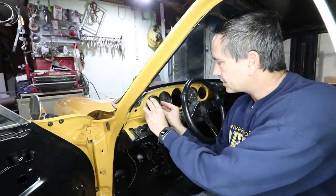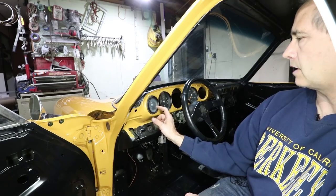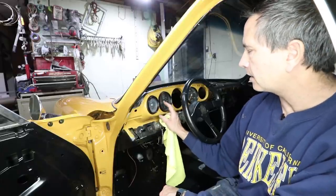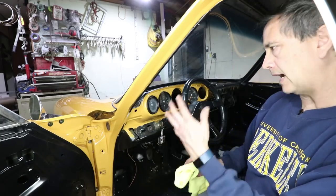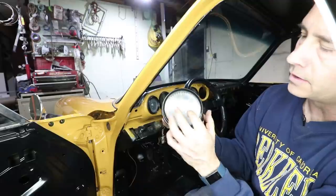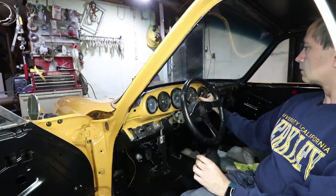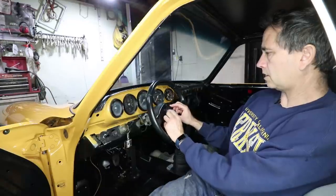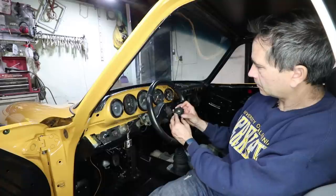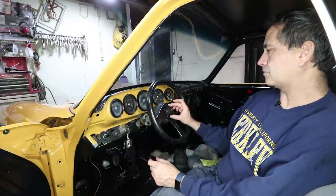Inside the car I'm loading in some more of the gauges. It's the fuel tank gauge — not even sure that's the right one. These gauges all need to be rebuilt. This one's got a really cloudy face, and this one the glass is also cloudy mostly on the inside. But I can read them — they just have to be rebuilt in the future. Same with the tachometer — it's really really clouded, but it is the silver dot. It's just a tiny bit too loose — I'll need to make a ring that's just going to center that and lock it in place. But I think that looks really good.